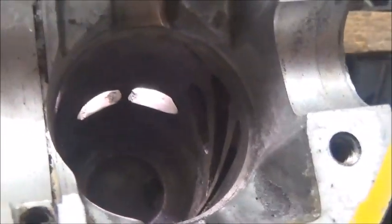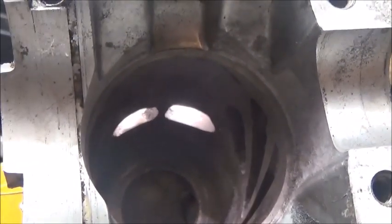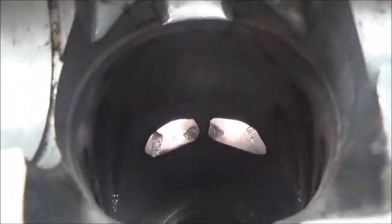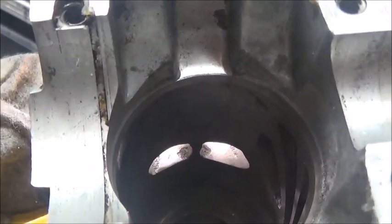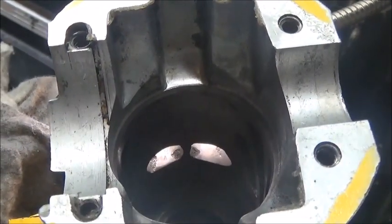The inside of the port, you can see dang near mirror finish on it. You're welcome to go back and look at the beginning of when we started and see to where we've actually somewhat changed the shape of that port, and it's somewhat wider, and at the end it's just a better, more high flowing port and going to make more power. And by doing that, we have probably altered the timing. Usually it's a degree or two.